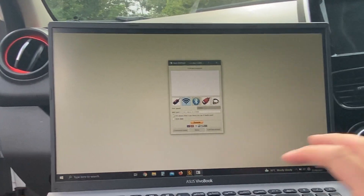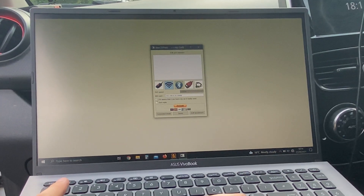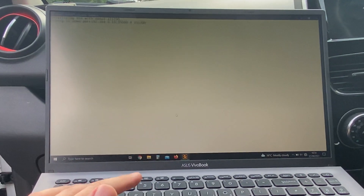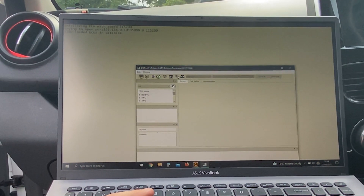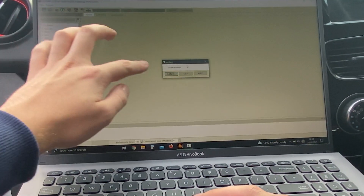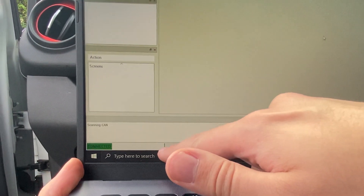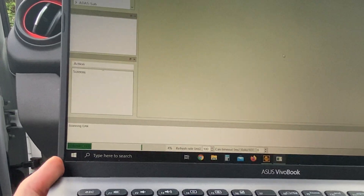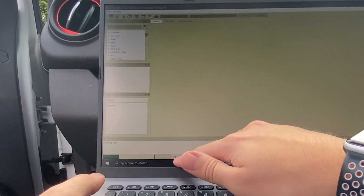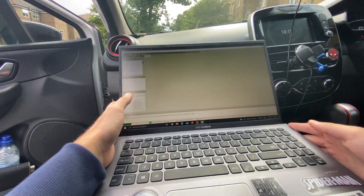Now that the ignition is staying on, we go to DDT4All. Click the Wi-Fi icon because I've got a Wi-Fi reader, click 'I am aware that I can harm my car' — you won't, but you know. Enlarge this, then click the magnifying glass and then click CAN. There's a green bar here which has to fill up to 100 — it takes about five or six minutes, so pause the video once it's at 100 and come back.